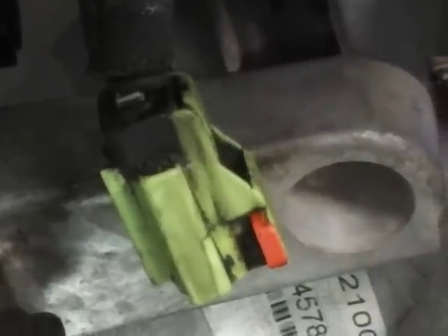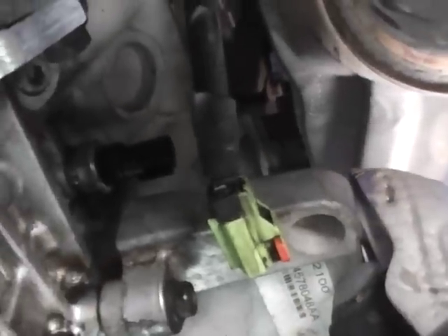I'm thinking that was the problem — we're going to see, because it's just like a dummy light switch that comes on. So again, that green little thing — just be very careful because it's hot and they're brittle, so do this on a cold engine. Just slide that off and then gently wiggle that one green connector off and take out the old sensor.